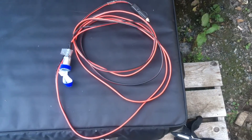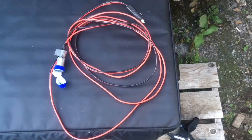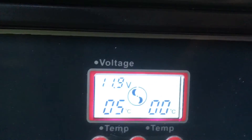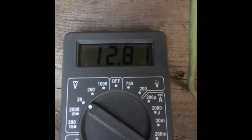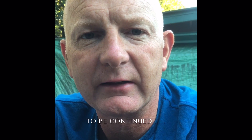I had a 14-foot extension cable in the circuit — I've just removed that and connected the fridge's own power supply directly to my charge output. I'm now seeing 11.9 volts at the compressor display versus 12.8 volts at the batteries, so I've lost about a volt. Four and a half days is still good with no solar recharge and not driving with it. It's a little disappointing from the calculator's point of view, but very impressive — four and a half days off-grid, no recharge, and this is working.